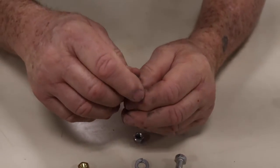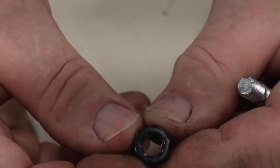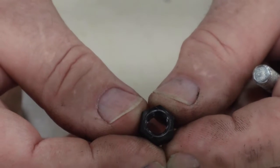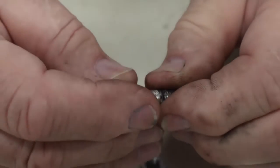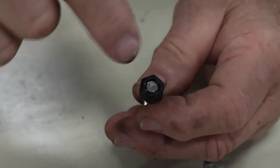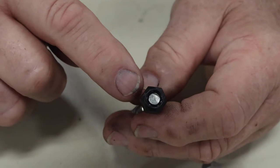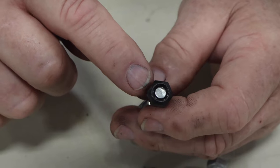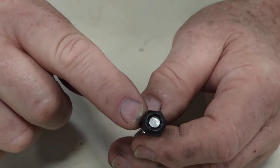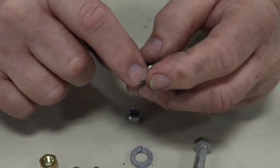Lastly, we've got a prevailing torque nut. This side of the nut is nice and round, but when I turn it over you can see it's a little elliptical — it's been squished at the top. It will thread on and then you need about five pounds of torque to carry it down. These prevailing torque nuts are for use on the manifold to hold it to the head and to hold the exhaust pipe to the manifold. You should use a little bit of anti-seize on them so they don't rust over time. We always use them when reinstalling exhaust systems and manifolds to cylinder heads — they're just great.